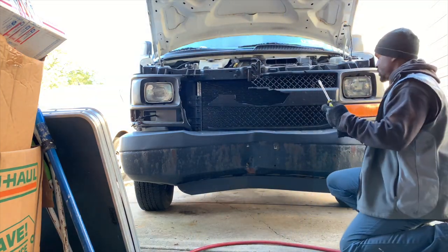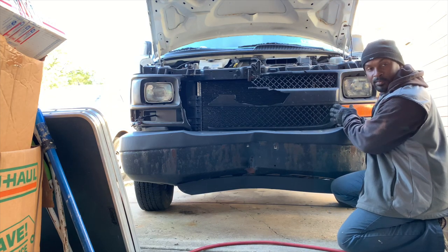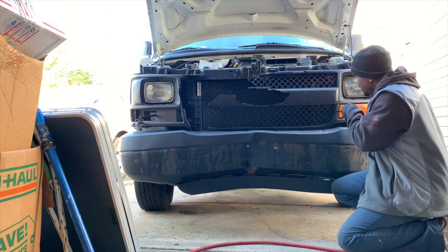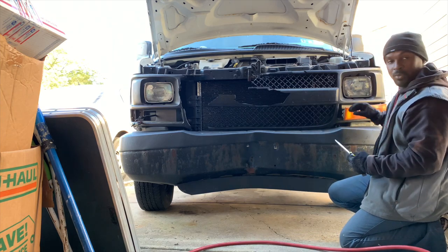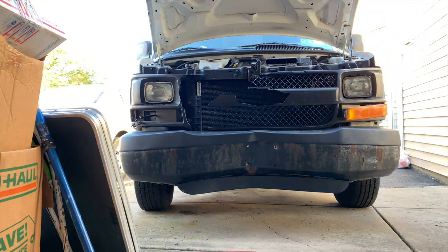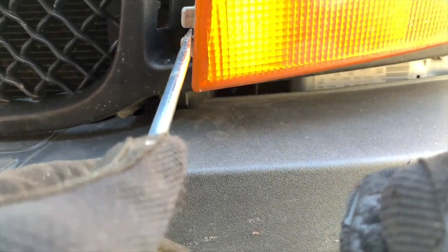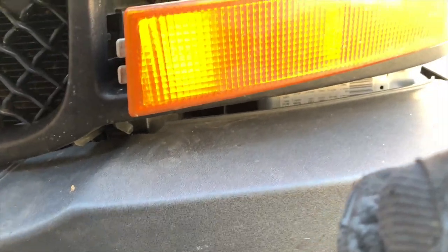Between the light there's a white tab in here that you have to push back on. Use the screwdriver as a brace — you've got to use some force, push it back, pull it over, and slide it out. You want to get the screwdriver directly between here; that's why you need a wide one. Otherwise a small one will go between the hole and you can wind up breaking these tabs. So you want to push in and use this as leverage and it pulls out.